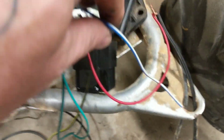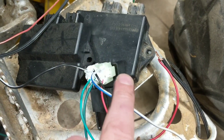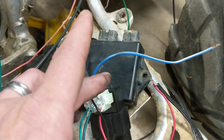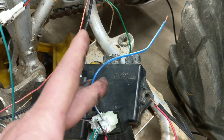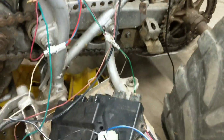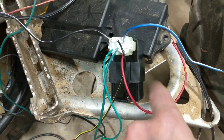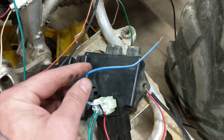This is a DC CDI, so I am running DC power to power this. The blue and white wire in the top-right corner — these could be different colors — it says it's for switched DC. I've used it in various ways and it honestly seems completely pointless, so I will not use it. This is where your CDI unit gets its actual power from the positive side of the battery. Bottom right we are running to the positive side of the battery. Top right is bogus — don't even use it.